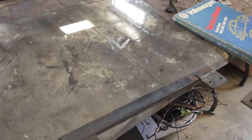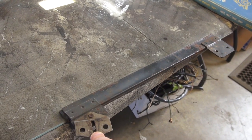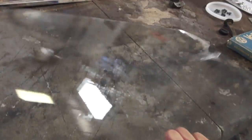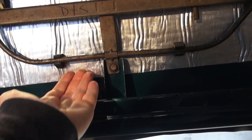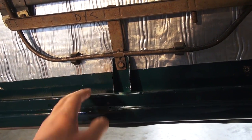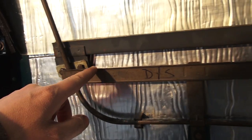Now for the glass — please check the glass and make sure the lift channel is in good shape. A lot of times they're rotted out and you need new lift channels; some on the market today are not exact so be careful. Leave the one bolt off and keep all the other bolts loose on the mechanism so you can pull the mechanism outward — it'll bend a little — and then insert the glass up behind it. You may need a second person to hold the door steady.